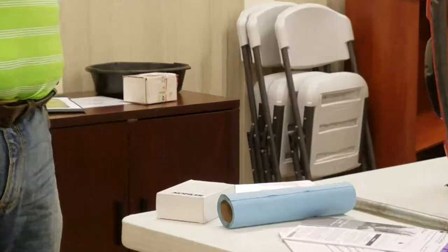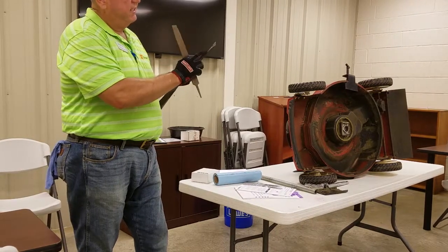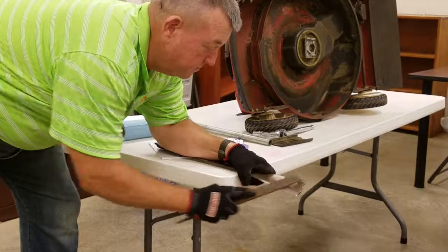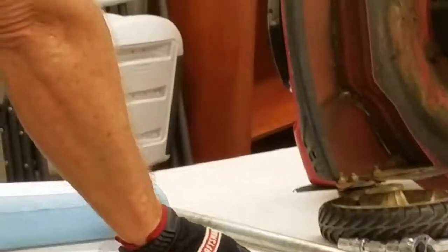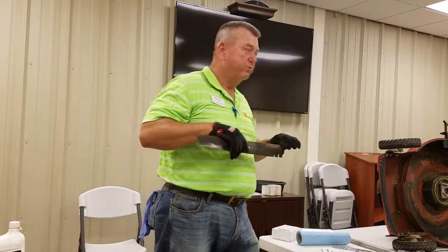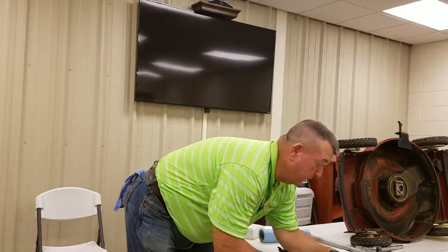Put the blade back together. If you have more than one bolt, alternate back and forth tightening them down evenly so you don't pull one side down tighter than the other. It's also not a bad idea to use a little spray lubricant like WD-40 on the bolt threads. So: we make sure we've got clean air, clean gas, enough oil, and a sharp blade. One other thing to think about is that anything that takes away from the airflow under the deck can influence the quality of your cut. If you have grass built up on the deck, and it will build up at some point, you need to remove it.